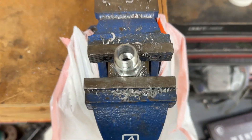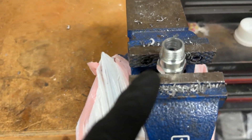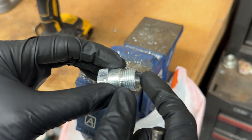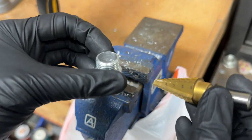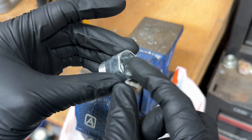We just made it through. But before you touch it, give it some time to cool down so you don't burn yourself, because this can get pretty warm after drilling. One final touch: clean up some of these metal burrs on the outside and inside with a drill bit that's a little bigger. But be careful using the drill bit on the inside, because you may end up ruining some of these threads.